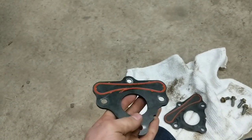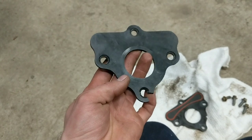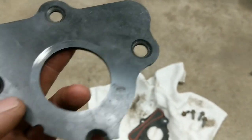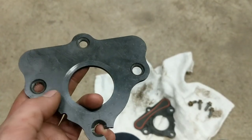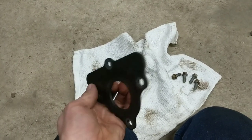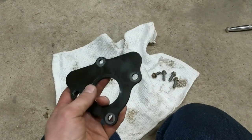So the next part here is the cam retainer plate. And as you can see by this broken area down here, we ran into a little bit of a snag. I wanted to torque these bolts down and we ended up with a crack there, and there also look like a couple other cracks starting in other spots. Not sure what caused this - if anybody knows or has seen an issue like this before, comment below. I have never seen a cam retaining plate split like that. Fortunately, since we have so many other LSs here, we have one of the older style cam retainer plates that do not take the countersink screws, and we're going to go ahead and get this installed and start getting the cam sprocket on and get it timed.